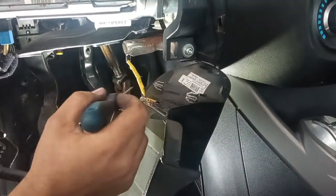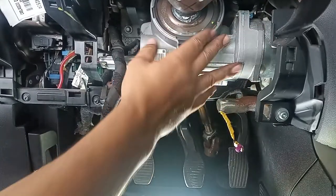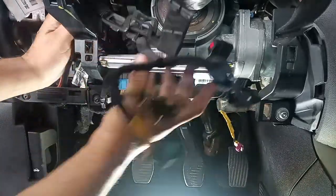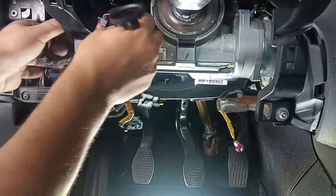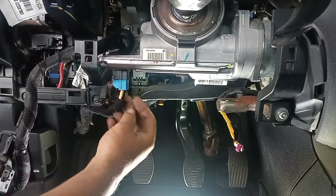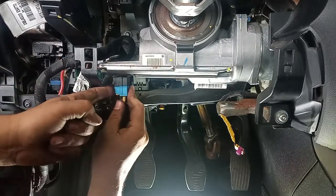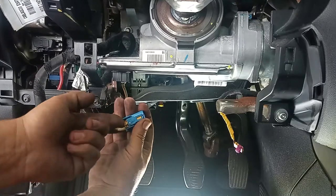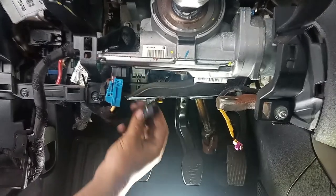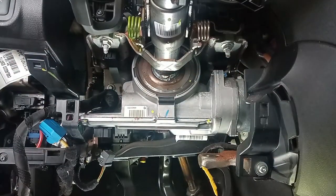I was thinking about this wire — maybe it's not necessary to take it out. The battery is off. This is very hefty stuff, very big. I advise putting this wiring to this side. Now we have the connector for the power — take down the yellow tab, push in the blue and it's out. Yellow tab down, then push. Here we have the communication connector, also moved to the side.